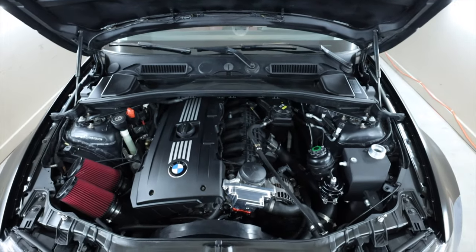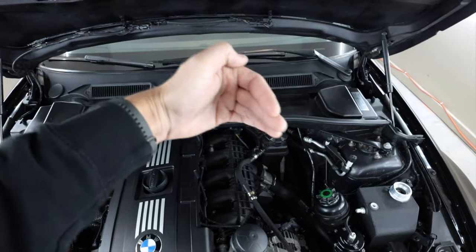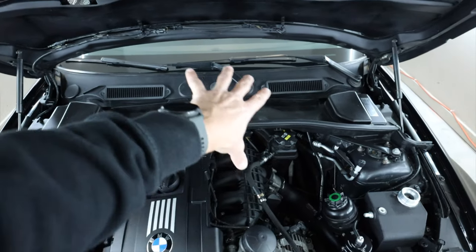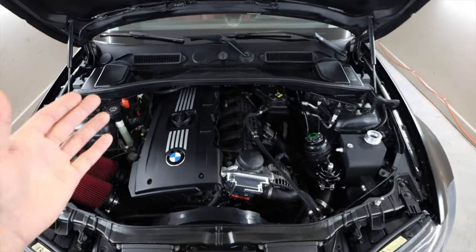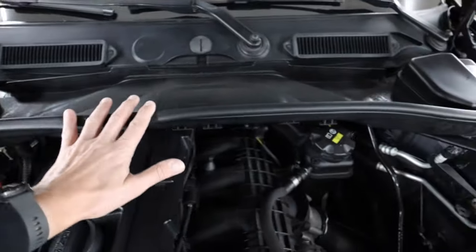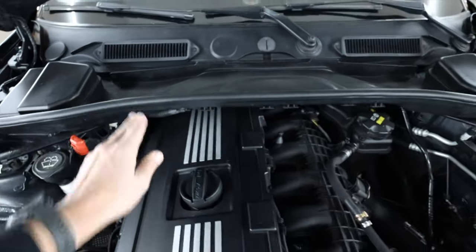I did a little more digging and found out a lot of guys actually just modify their factory 135 or N54 335 cowls and basically just recess this piece back here and remove this center section, which does a couple of things. One, it just looks a lot better and cleans it up. Two, it makes it a lot easier to work back there for things like the manifold and spark plugs. I'm going to do the best I can today to do a very clean DIY on this. The only thing I am waiting on is the actual seal strip - you got to buy a longer one because now this will have to travel all the way back here, so I may not have that in this video but will have it in the future.